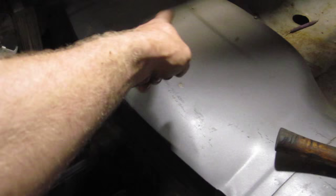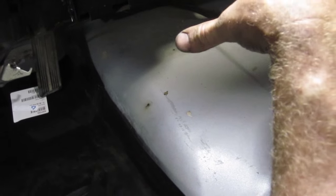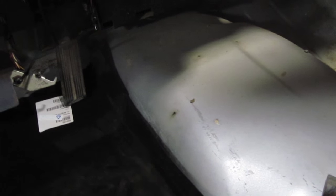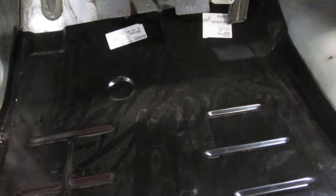After that we'll cut some holes for our shifters — four-wheel drive and stick. What I'll probably do is cut the floor out of the regular cab larger and then put that right over top, screwing and siliconing it around the outside so we can take it off and still access the shifter underneath. We didn't cut a hole in it just yet, so the top shifter cover's off. We're gonna make it so we can put it in through that access cover and remove it afterwards if needed. I'm not totally certain about that transmission yet.